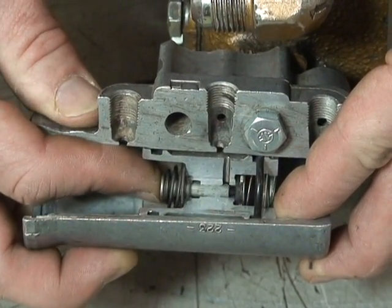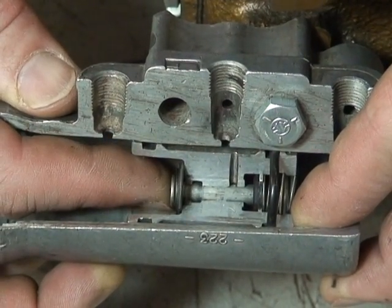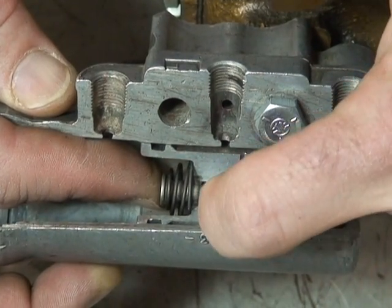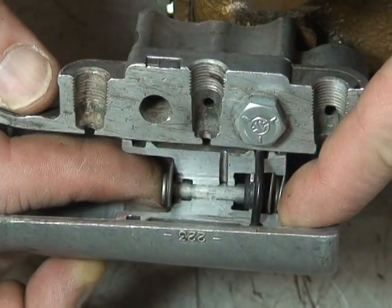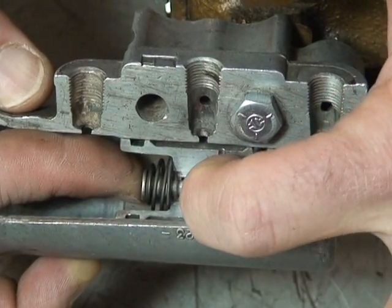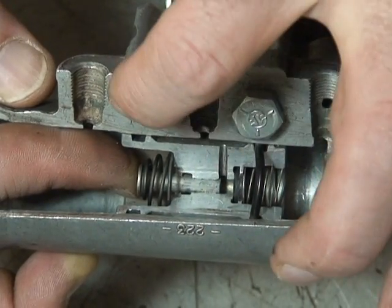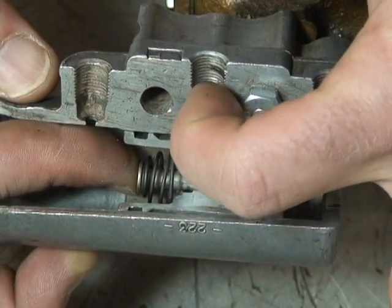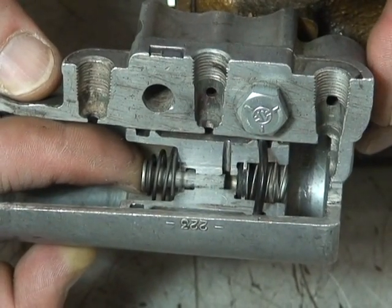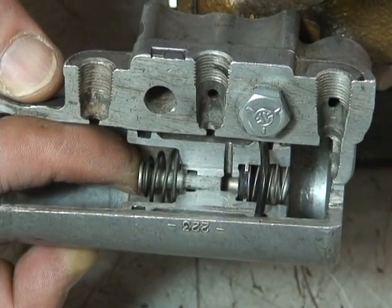So we've sealed our exhaust and now we've opened the port from our supply tank right here at this inlet exhaust valve. Now we supply air up through the little hole in the piston between these two o-rings, out through this passage, onto the unloaders to hold the intake valves open in the compressor, and to hold the purge valve open in the air dryer.